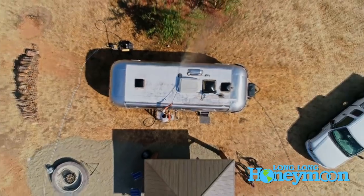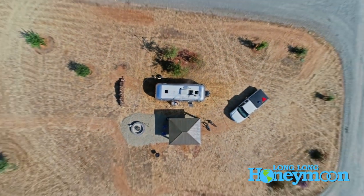Use lots of water, then let it dry, and you've got a good surface to inspect for leaks. If you're up on your roof and it's nice and clean, I'd recommend that you don't wax the roof — waxing the roof makes it very slippery and it's a little bit dangerous.